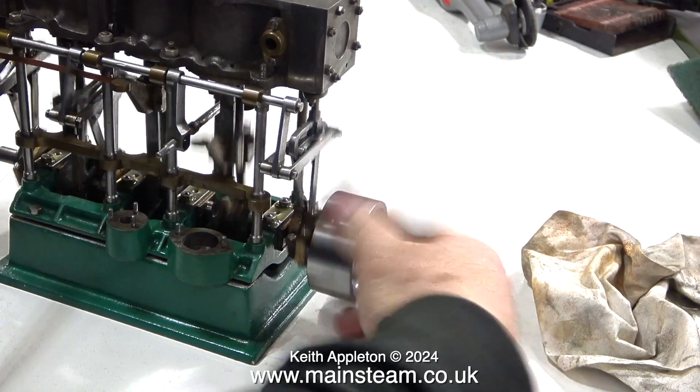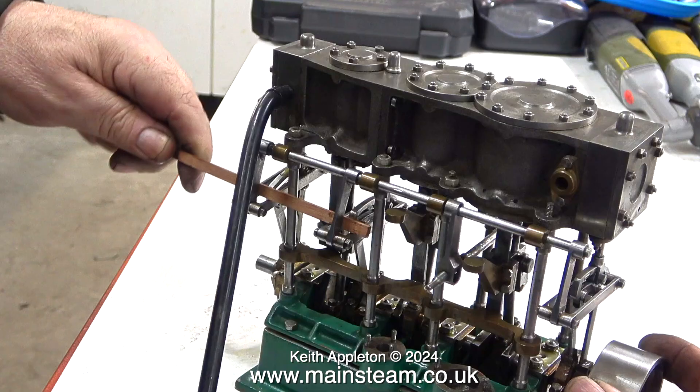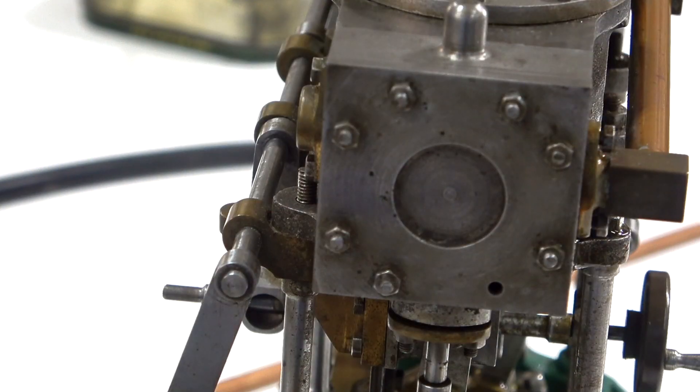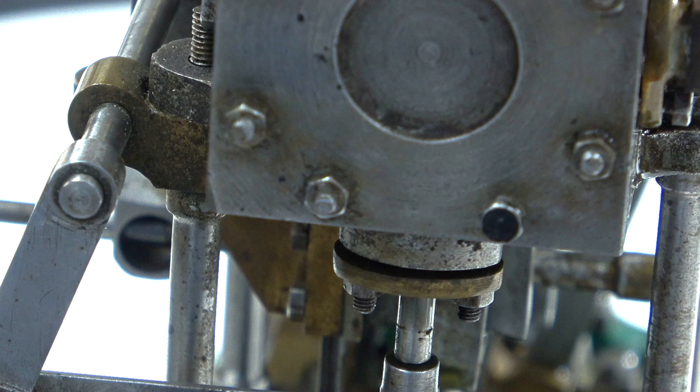The valve timing is well out. To be honest I was really expecting far too much — it would have been nice had it roared into life, but alas not. This missing stud looks ominous. I've not been inside it, but if I was a gambling man I'd say the stud has sheared off in the cylinder block. When I push a small bolt into the hole it stops dead when it should go into the cylinder block. Drilling out these small 7BA studs is a real pain — the steel they're made from is actually quite hard. I'll show the repair process in a later episode.